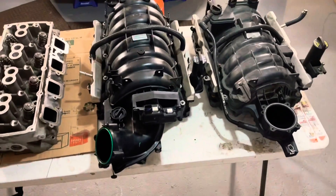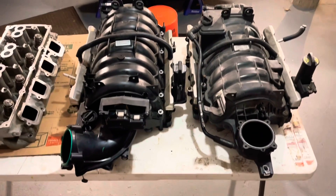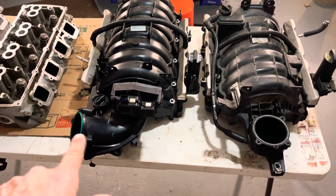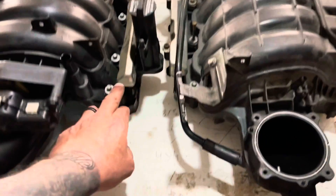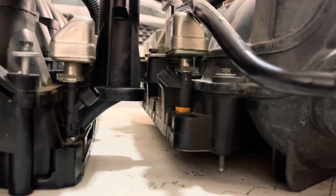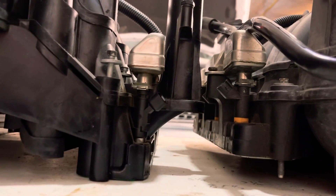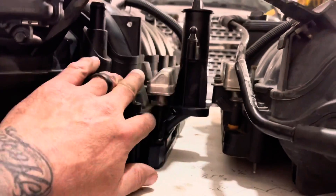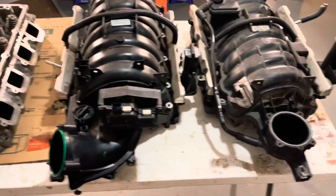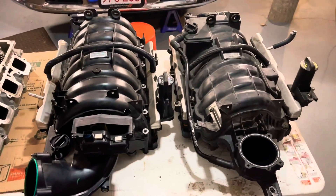Let's flip these over and get the caliper out — I'll show you the differences in intake runner sizes and throttle body hole sizes. If you plan on sticking with your 5.7 injectors, you will need a spacer because the 5.7 injectors are a little smaller than the 6.4s. I'm keeping the 6.4 injectors so I don't have that issue. Also, anyone with a stock intake doing this swap will need an extension for your IATs — your intake air temperature sensor.